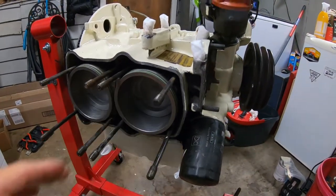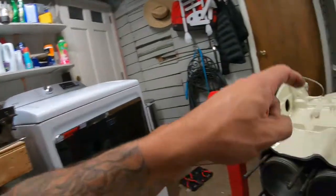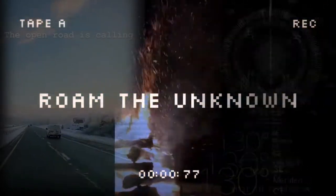We got these things nice and secure in the block — O-rings are on the rear and in the top half. I had a realization while rotating the engine: the pistons are very tight inside their cylinders, and when you rotate it, it actually creates enough friction to pop that jug right out. So I can't get the other side reassembled for that reason. I think I have to actually put the head on so we can get the other jugs in place. So I'm doing heads today.